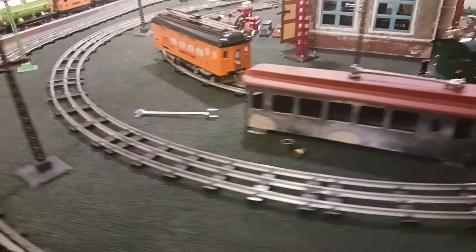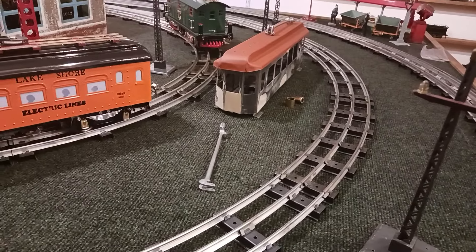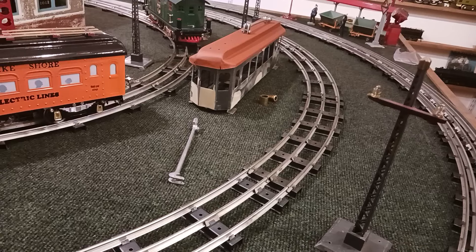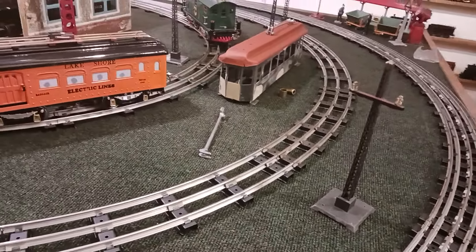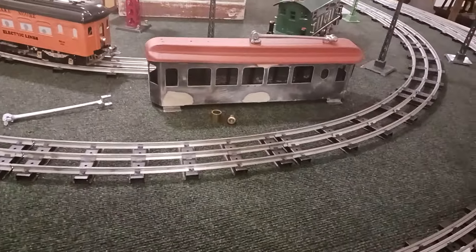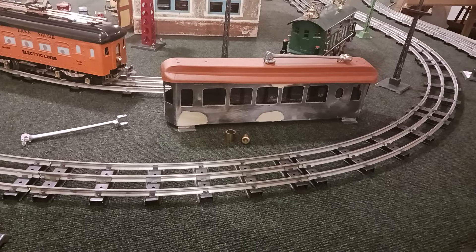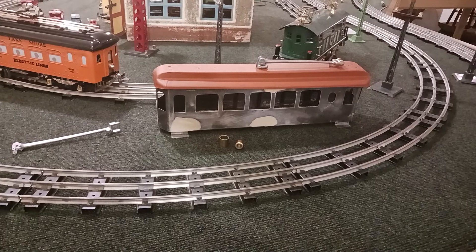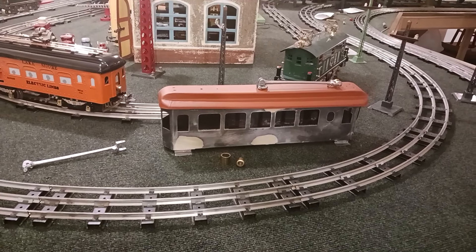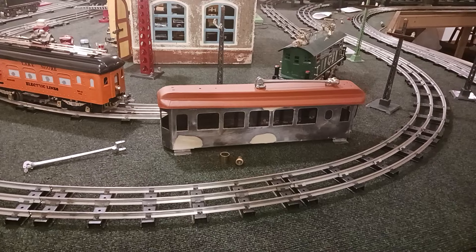That's what happens when you leave stuff on the floor. On the other side it was actually fine, but it had been clipped together so much that it pulled in that center panel. So I put a light glaze on that and filled that in, got it nice and level. I've got another spot on the other side that's curing. As soon as that's done I'll be able to sand it down. Actually, I don't sand this stuff — I use a file on it, a flat file. I take it down exactly where I want. It shows where any low spots are, and then I glaze it again and bring it down with the file until it's flat all across. Then I feather it out with sandpaper.